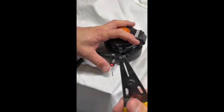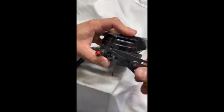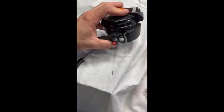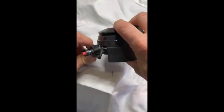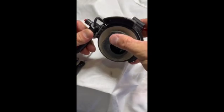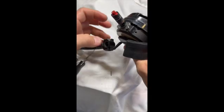After I get that off, use a pair of split ring removal pliers — I like the angled ones personally. I'm going to go in here, line up the pins, and remove that next. After that, this piece will slide off. Pay attention to these square pieces because they're going to go towards the regulator to hit that little limiting screw right there. Slide that off.